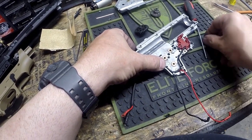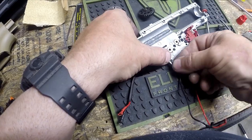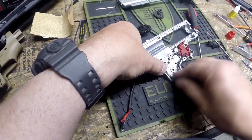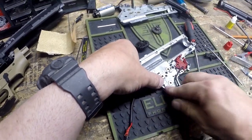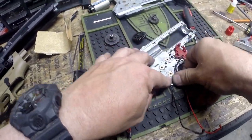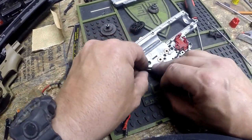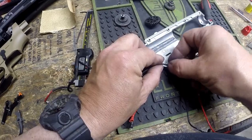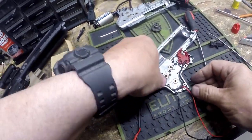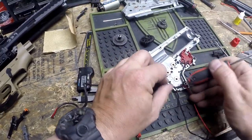GNG's got these little clips — they just fit in. When you're putting these clips in, don't be too aggressive. Put them in nice and easy. If it feels like they're going in hard, don't force it, because if you're forcing them you're probably going to end up putting a short in the wire and you're going to have problems again. Just go nice and easy. If you're in a rush and you're trying to do this, you're probably not going to do yourself any favors.